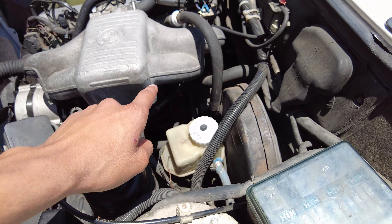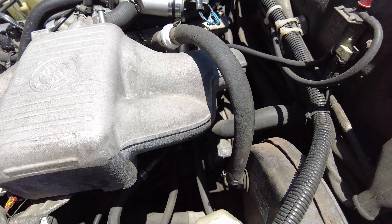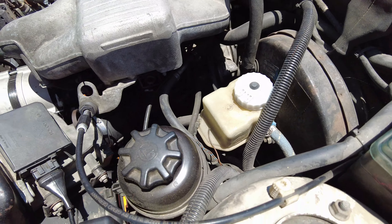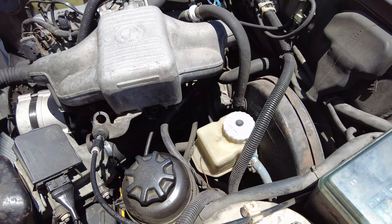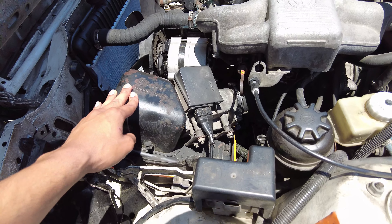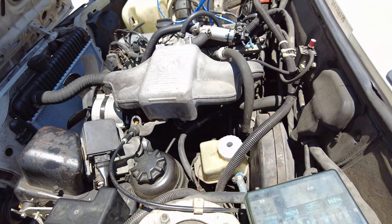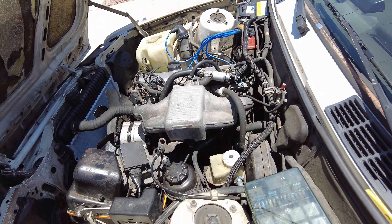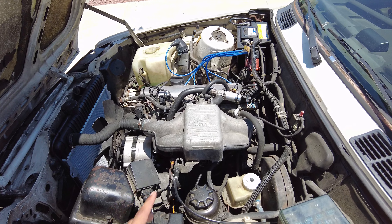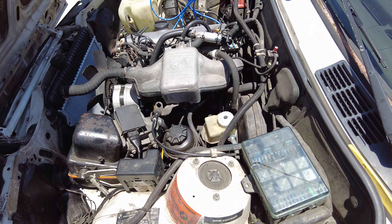Your starter is going to be located under your intake manifold on the E30. In order to get easier access to the starter — the bolts are right there, it's pretty dark in there, but there are two bolts connecting the starter. In order to get easier access, you probably want to take off your intake and then take off your intake manifold. I know that seems like a headache, but it makes the job a lot easier, though more time consuming. Or you can take off your intake and just try to fit your hands in there and deal with it that way.